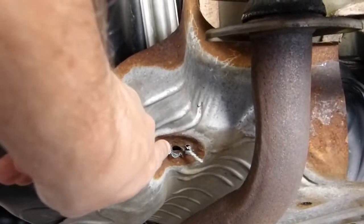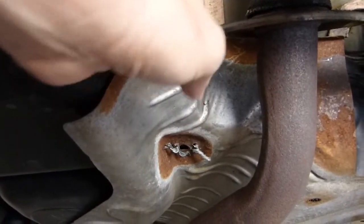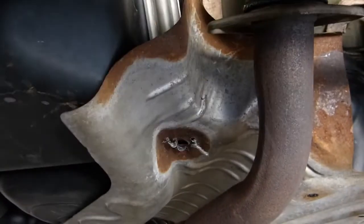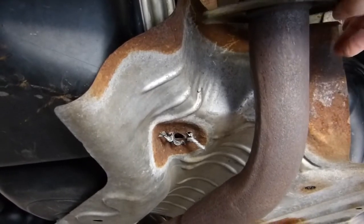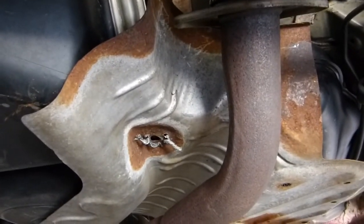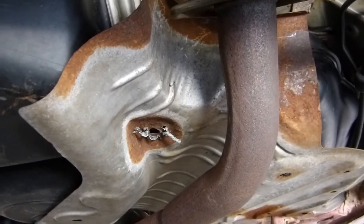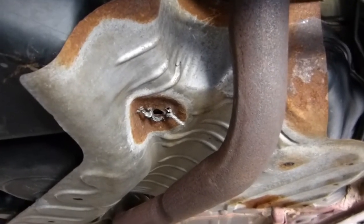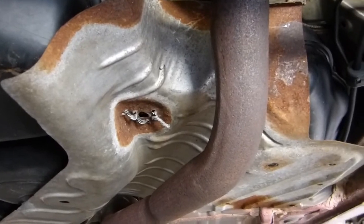You can see the wires are twisted together and tightened up, and the heat shield is up and tight. It should be okay — I don't know if it's going to rattle a little bit, but at least it won't be hanging down on the exhaust. That should hold for at least a couple of weeks, probably longer. But I think I'll still try to get a proper hanger for this at some point and fix it while everything is still easy to get to and not too rusted.